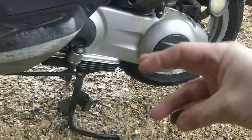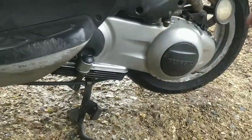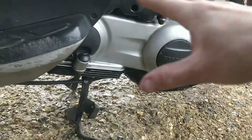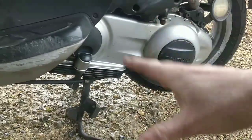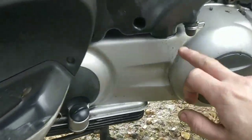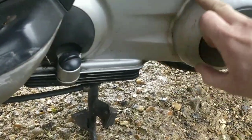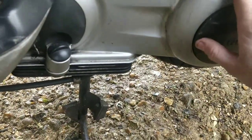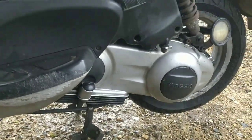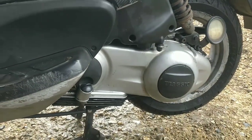What happens is when the bike goes on its side, the oil travels up past the piston and it comes out the only place it can, which is into the airbox. So I'm pretty sure we'll be popping the airbox off this — there should be a little pool of oil in there. We'll be cleaning that up and then you shouldn't get any more, because there's nowhere higher than this. The only place it can be is the airbox, which is fine — that's an easy resolve. So let's pop this off, let's see if I'm right, let's see if there's oil in there, let's clean it out and this should be done and dusted.